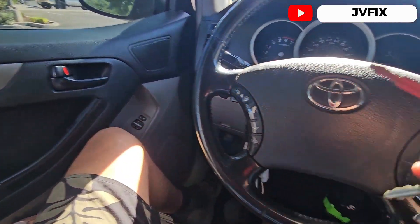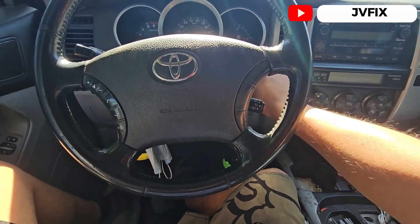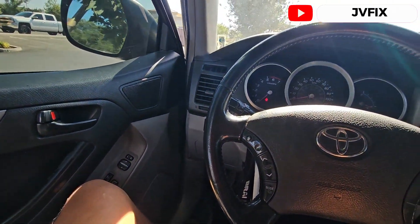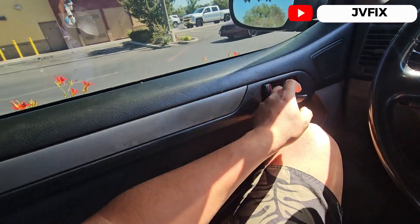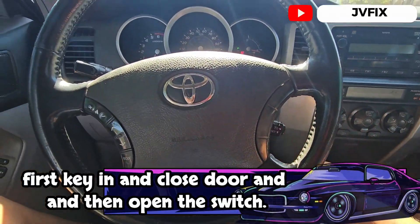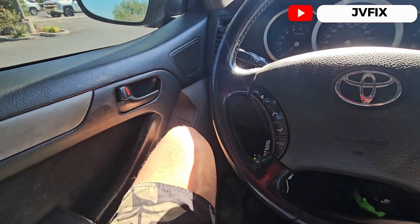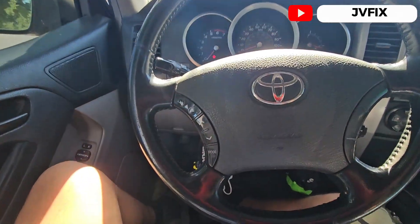You've got to open your door — it must be unlocked. Insert your master key two times into the ignition, take it out, close the door, leave it open, then insert it once, do the same procedure again — one, two — leave it open. This time insert the key and open the switch without starting it, close the door, take out the key, and you'll hear the lock cycles.